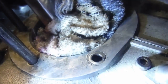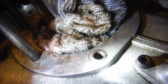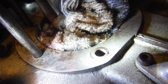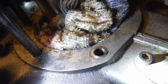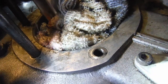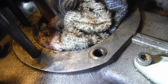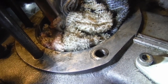And that's it there - it was a high tensile bolt and I bored it in the lathe first of all, centred it up and bored it through, then cut it to a length just a little over what I needed and managed to tap it out. When tapping out something like this, you've got to really start it off in a lathe because you very rarely get it dead concentric all the way through if you do it by hand.